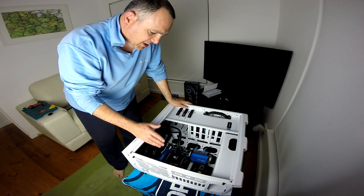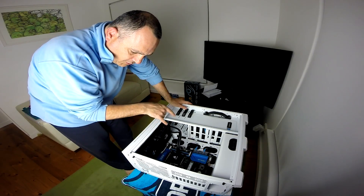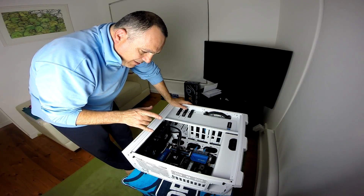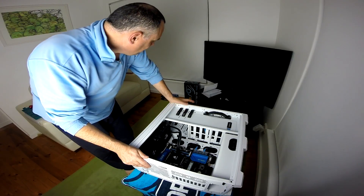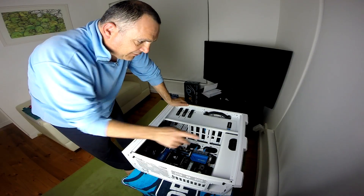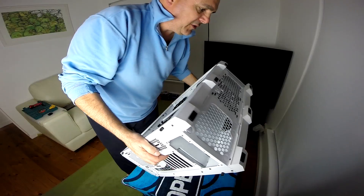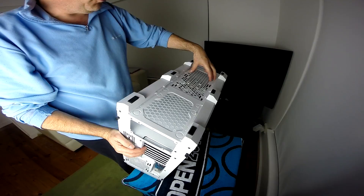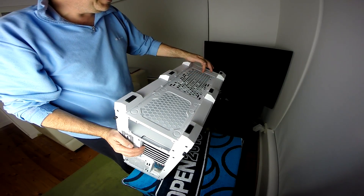RAM is missing from here. Power supply needs to go to the two main points on the logic board — the motherboard — and the video card, and that's about it. So: RAM, power supply connecting, and video card, which is there, and it will go in in a minute. I've got the fan at the bottom which I didn't have before, so that's been fitted there. There isn't really much reason to put another one there because it's closed, unless I remove the hard disk box, so I'll leave it as it is — it doesn't need it.